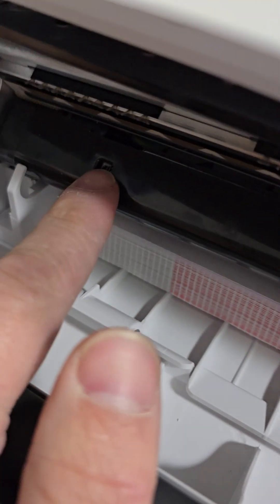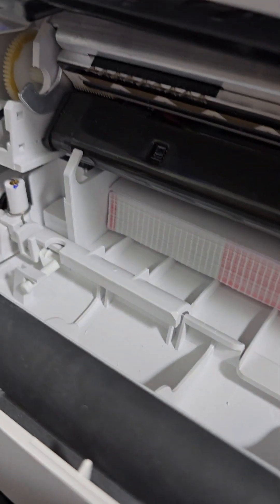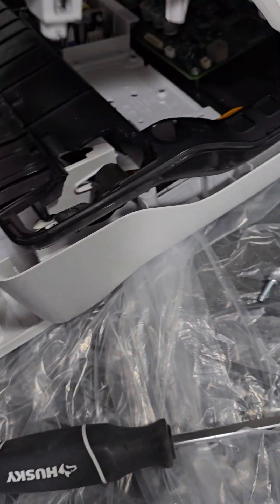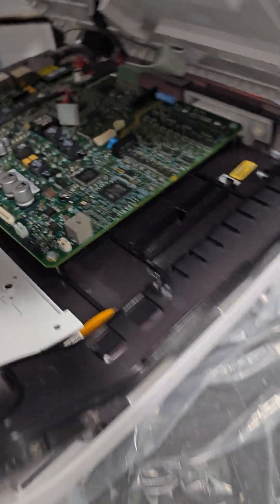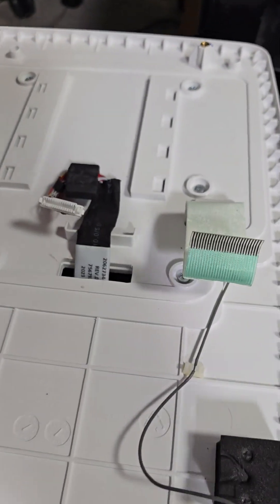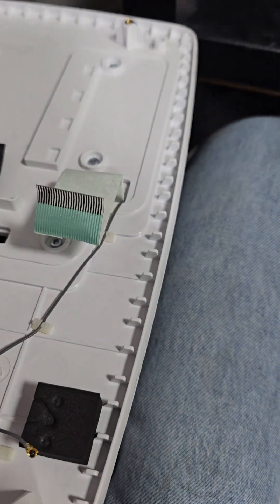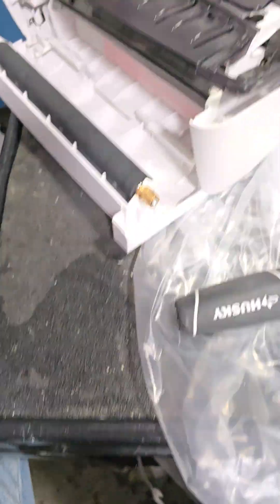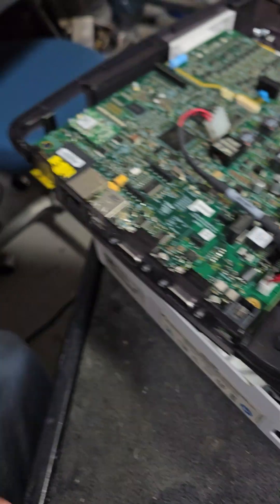Make sure it's clean. When I opened it this was empty, so I could see that was off. Now I'm going to pull the whole paper tray assembly to get to that. There are four screws on the underside to pull the cover off, then there are three cables: a molex connector, a ribbon cable — and be careful with this one, it's your communications Wi-Fi cable. Pull those off. Before that, you're also going to have to open the paper tray to release it, and then there are two clips that go through here — you've got to release those from underneath to separate.